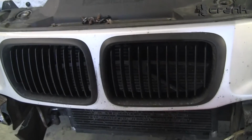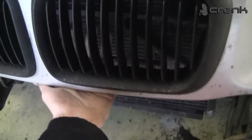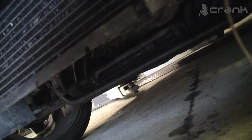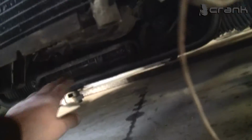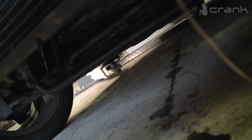The hydraulic fluid heat exchanger on the M44 was installed behind the grills, and on the 2.8 it's down on the rack. So you need to take the heat exchanger from the 6-cylinder. We take it from a 2-liter engine. It's right below the strut. Actually, you need to take this strut too, because on the 6-cylinder it's different than the 4-cylinder one.